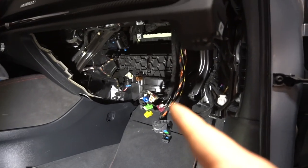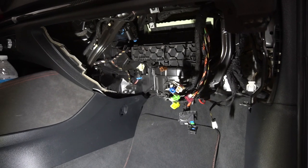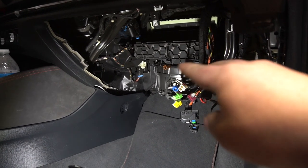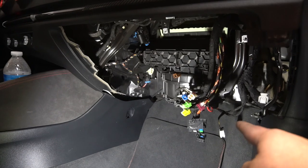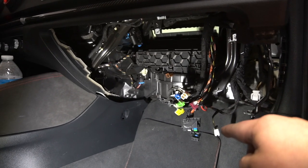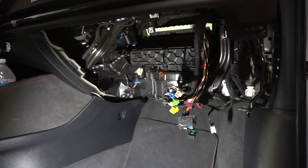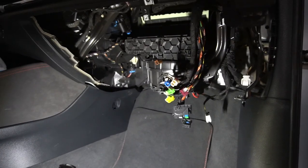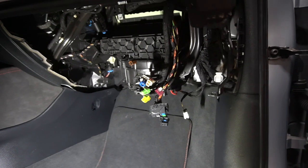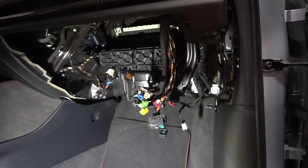Here's the inside of the glove box — I ended up removing it. One of the places we talked about putting the S7 ECU is inside the glove box along with the adapter, and yes both of them fit. Another spot we considered was high up on the footwell, covered about 80% by the underside of the dash, but it still left a portion of the ECU uncovered. I didn't feel comfortable with that because a passenger's feet could potentially kick the ECU, shut off the car, or rip a wire.